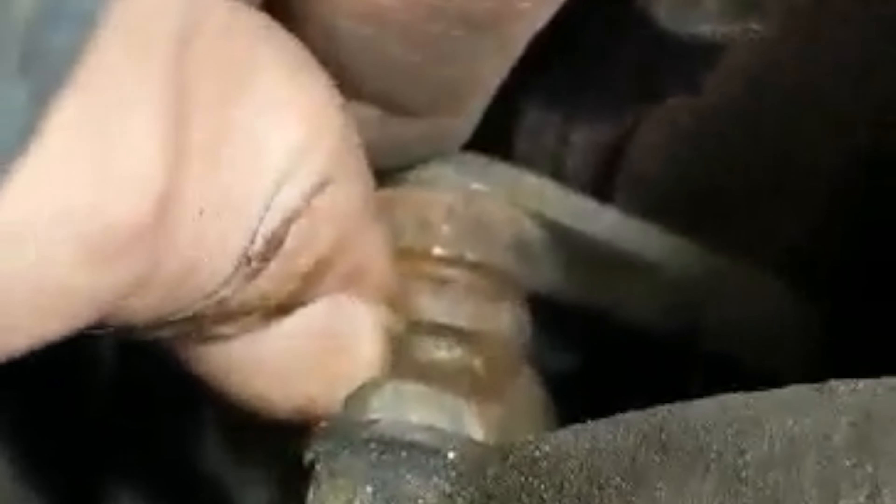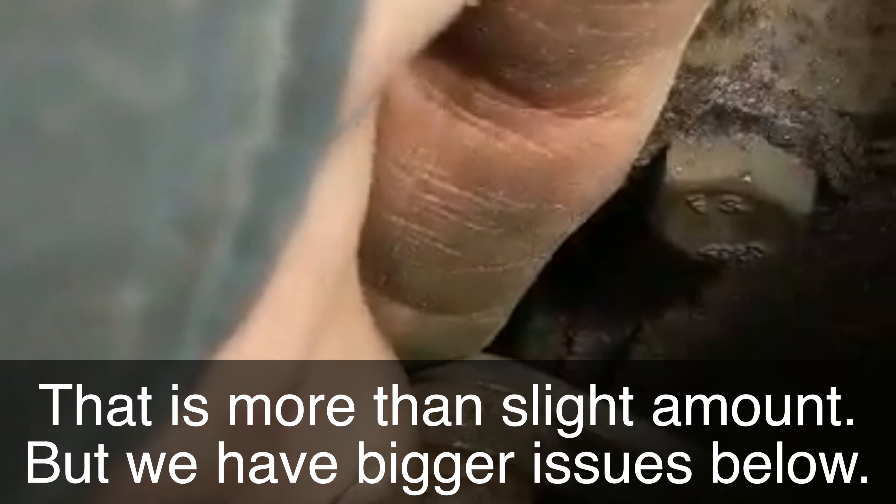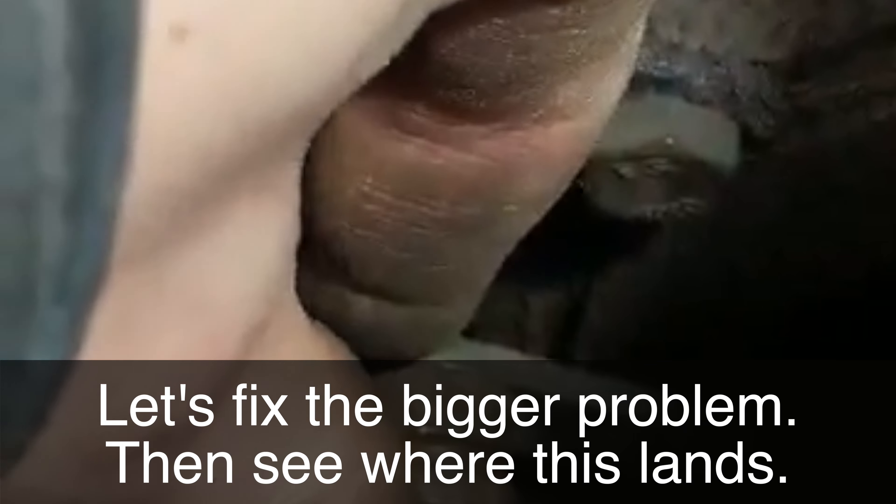Per your video it might need clocking. Right here at the very top this piece doesn't fit on there — it goes down there before it fits. Is that a slight amount where it's probably okay, or should I maybe clock that turbo before putting this all back together? But yes, definitely just rusted shut.